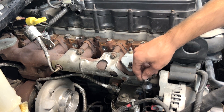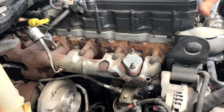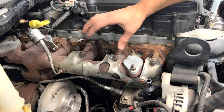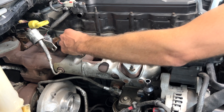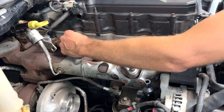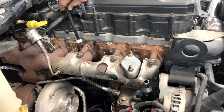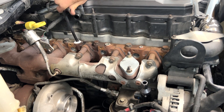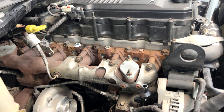Now that we have our coolant riser tube reinstalled with the factory bolt, we're ready to finish off the install. The first thing to do is plug off where our coolant used to go to the EGR cooler. We're going to put in the plug supplied in the kit into this hole — put a little Teflon paste on there to help lubricate and seal it, since it's pipe thread. This is a steel plug going into a cast iron head, so don't be afraid to get it good and tight.